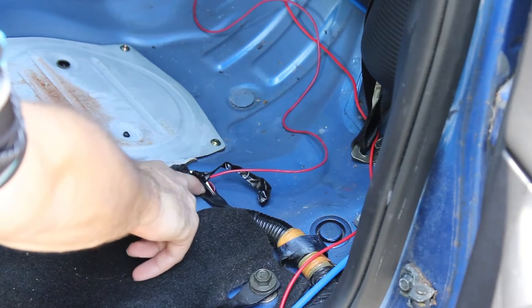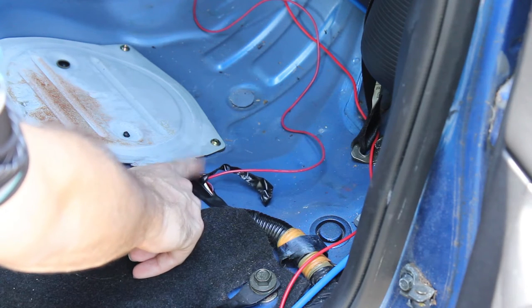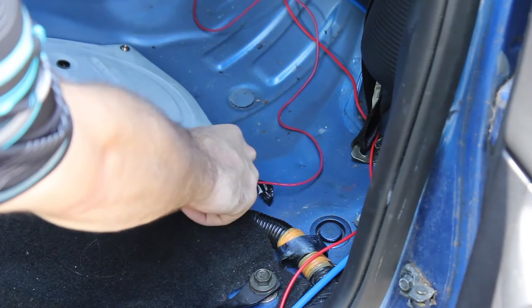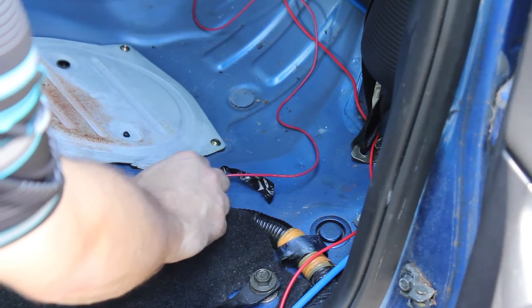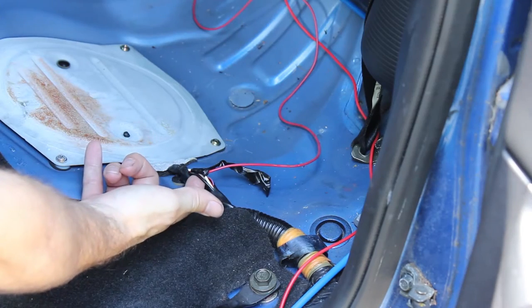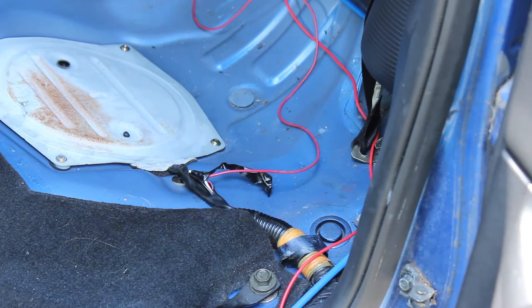Here we have the wire bundle going to my fuel pump. I've already spliced onto the hot wire going to the fuel pump — that actually goes to feed my water injection pump. The black wire, the fuel pump ground, is a nice hefty gauge wire. Out of the three wires that are up in the front, there's only one that's this gauge. That's going to be the ground.